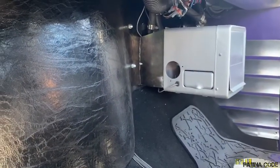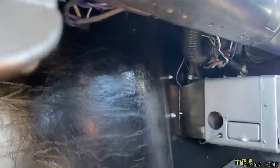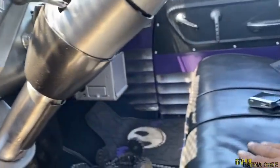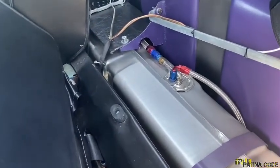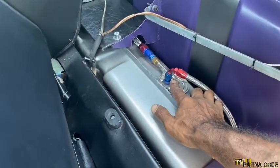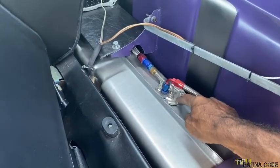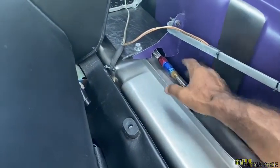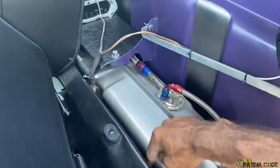The heater is connected and we're yet to get our ductwork from there to the vent up top on the truck. Back here behind the seat — the seat came from a 1966 — there's our sending unit all hooked up. We need to put the connection to read the fuel and then we need to ground it. So we'll put the ground wire here, attach it, and then the sending unit signal will come off of this and run down underneath.